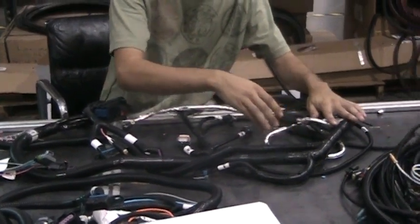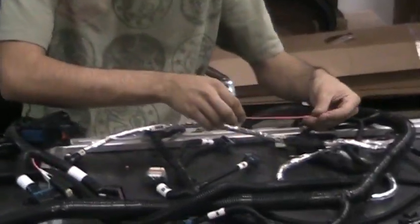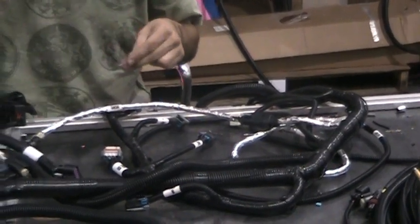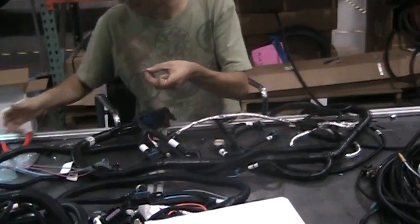The female side will always be on the wiring harness. This will demonstrate the wires that are inside of here. To use the Molex stuff, you basically get a connector — this is a male connector.